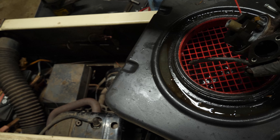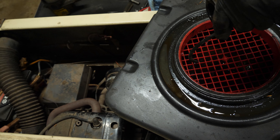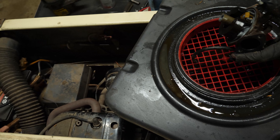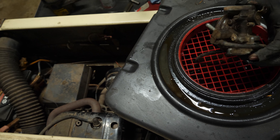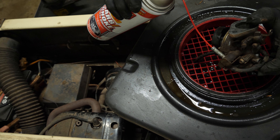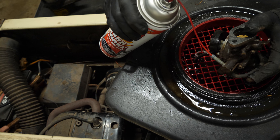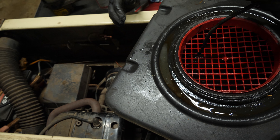I'm not taking the float off this time. The reason for that is these older carburetors — when they get brittle like this, sometimes you can break the float. And there is gas flowing through it. I'll put a little bit of carburetor cleaner in here and I can see it bubbling out of the float valve. That's why I don't really feel the need to take that float off.